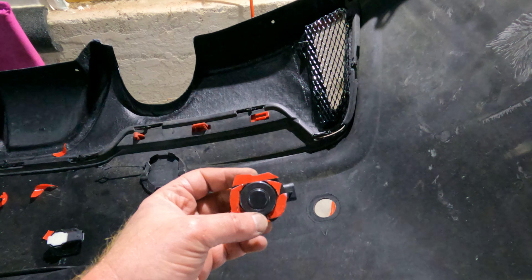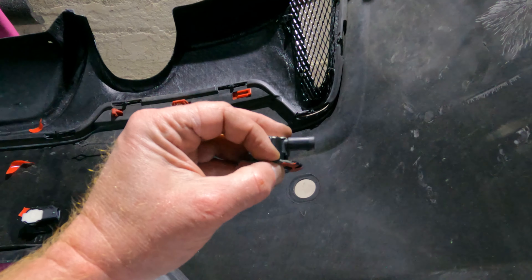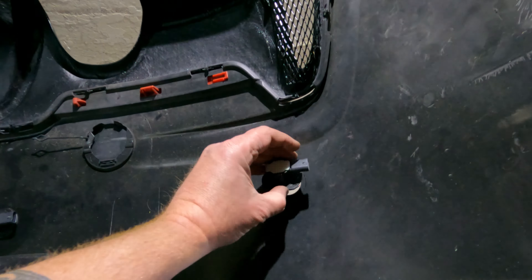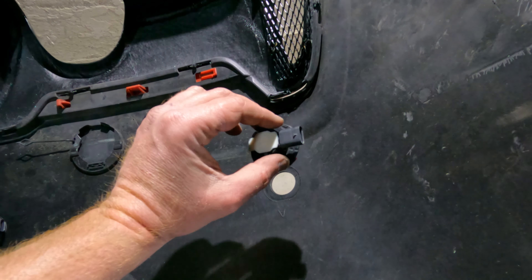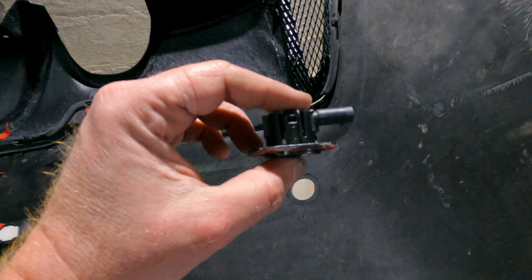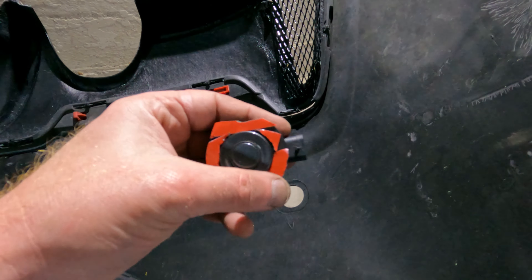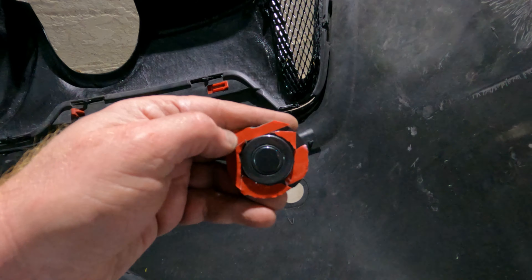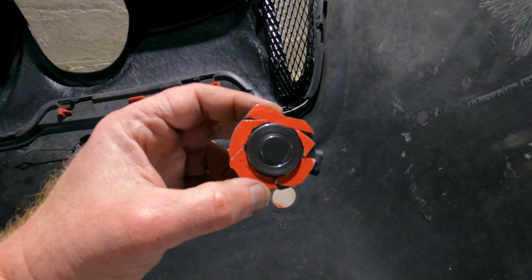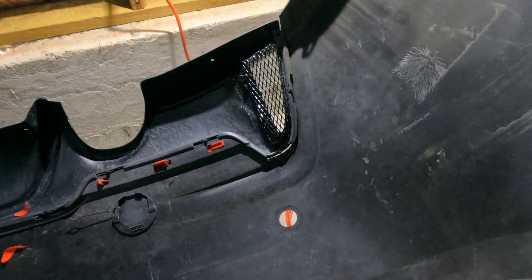Here is my PDC sensor — I've got the double-sided 3M automotive adhesive. The one thing you want to make sure is to get as thin as you can get, because if it's thick it's going to make the sensor set back deeper inside your bumper. Just put it on all the way around — I used pieces and got it to match. I'm going to set this into place, and really all we've got next is putting the bumper back on.